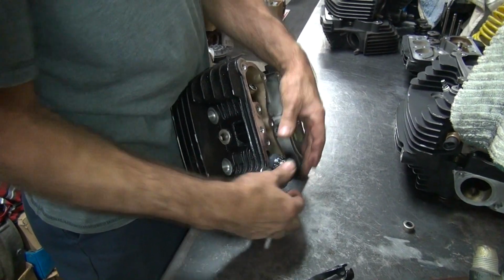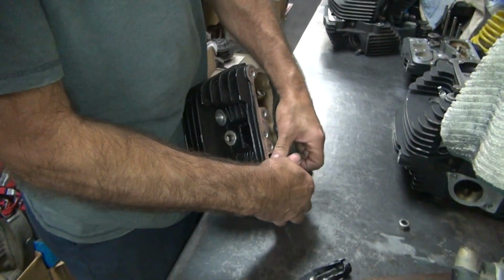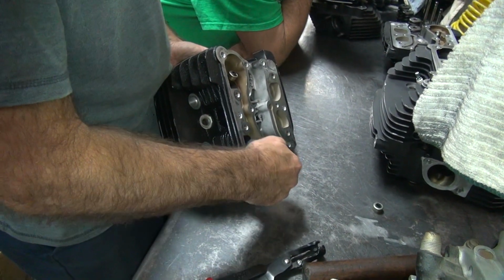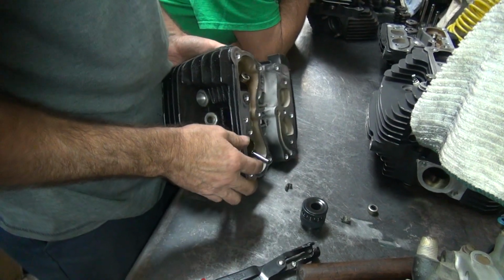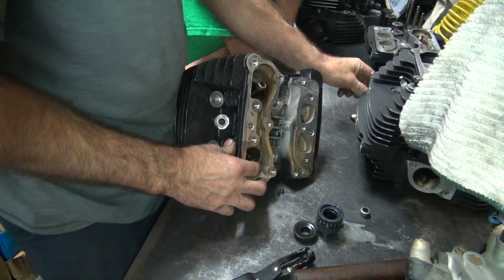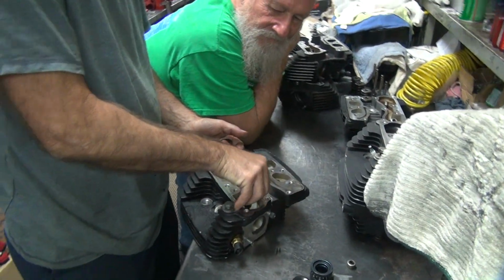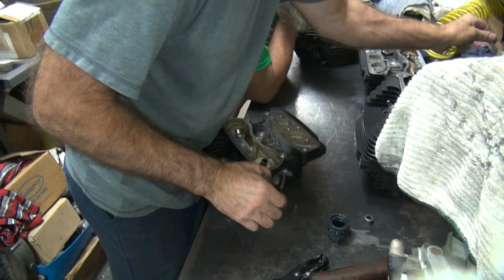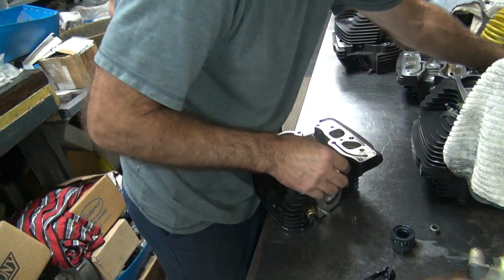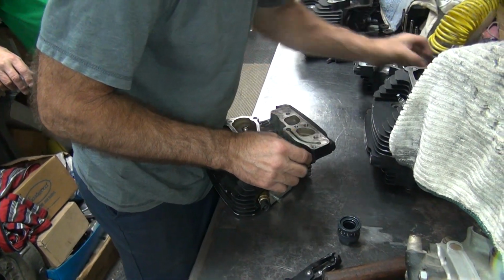So now, center up. Yeah, well, he's paying for it in shims. We're at 94. So that's pretty close to our 90. It's 94. So he's good to go. But we haven't checked our seal clearance. Seal's gone now, right? You can put it back on just to check your seal clearance. We'll check the exhaust.